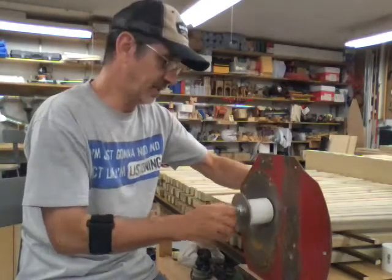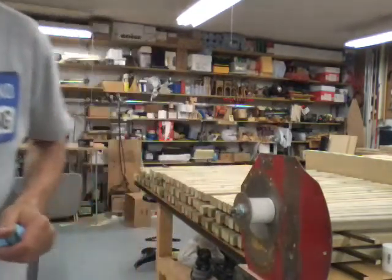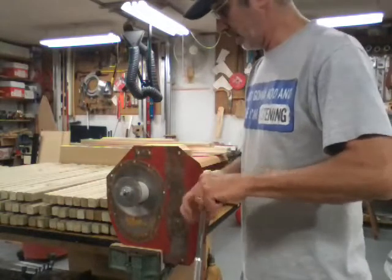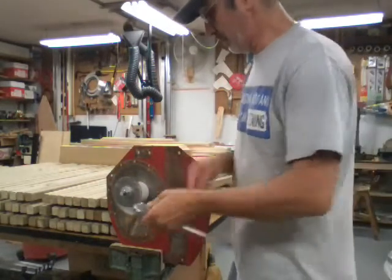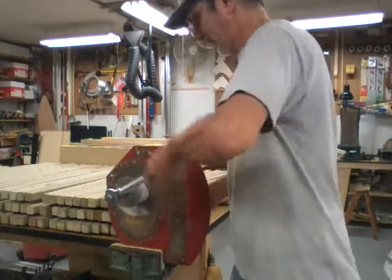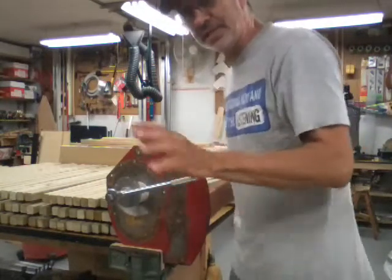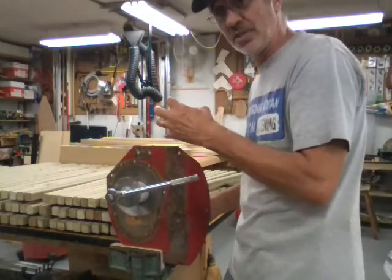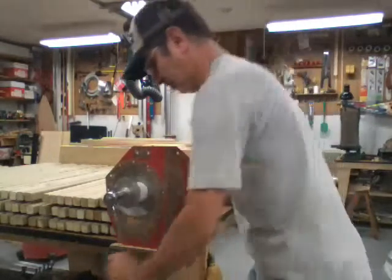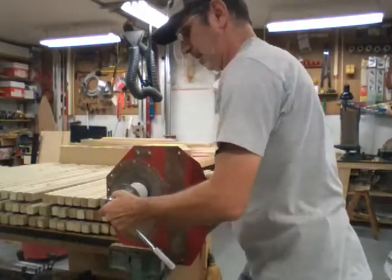It's a bit clumsy to get this thing all screwed together. Now I'm going to grab a ratchet and a wrench — which I forgot to grab before I started the camera. Get this thing lined up as best you can in the center of the bushing and just tighten it up, and it will pop that bushing right out of there. Now that popping noise is not the plastic breaking — that is the bushing starting to pop out and move.